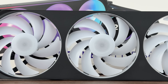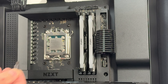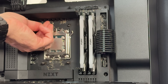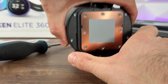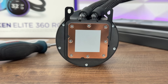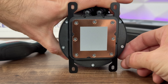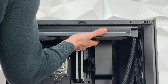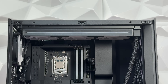The F360 RGB Core makes installation quite simple. For the AMD installation, you remove the original brackets, and you have pre-applied thermal paste so you don't need to worry about that — just be careful not to touch it while removing the plastic cap. You slide out the top and bottom bracket parts for Intel and place the AMD brackets back. Then remove the original retention brackets from the motherboard, place the four standoffs which have two different threads on each side, set the block on top of the processor, and use four thumbscrews to lock it down.